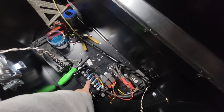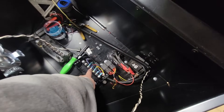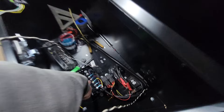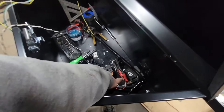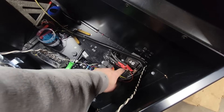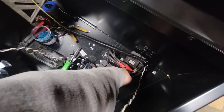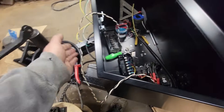We're going to use that module. We need the battery charge line because we need battery positive coming in to charge the group 31 we're putting up here, and also to have battery so we can flip a switch and turn on our load lights. We don't want the winch trying to draw power through here from the tow vehicle, so we're going to put a self-resetting circuit breaker in line - 10 or 15 amps - that limits what can be drawn off the charge line. If it heats up and starts pulling more than that, it trips the breaker and you're disconnected, so it can only pull from the battery.